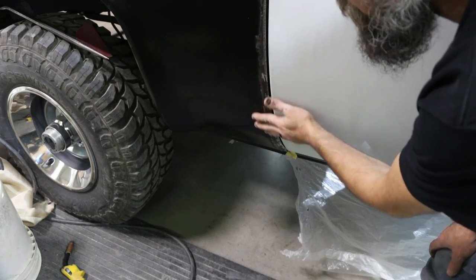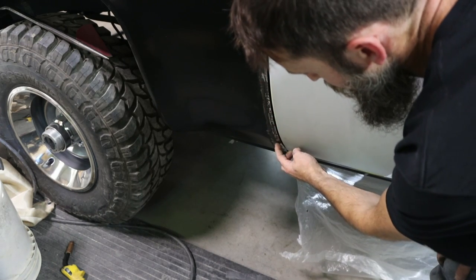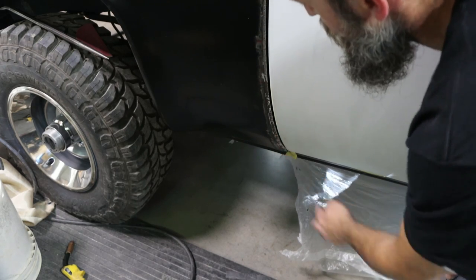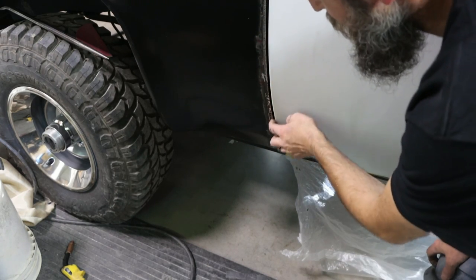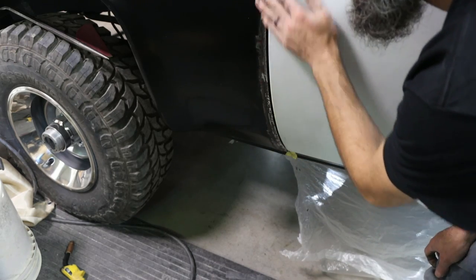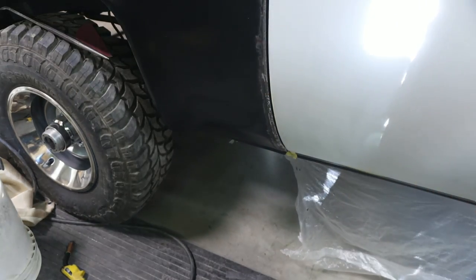It's tough to do that to a new fender. But if you want them to fit, that's what it takes. We've got 3/8 of an inch of build down here. Yeah, so there you go. You won't knock that off with a shopping cart at Walmart. So now just a little filler and block it out. Be good to go.